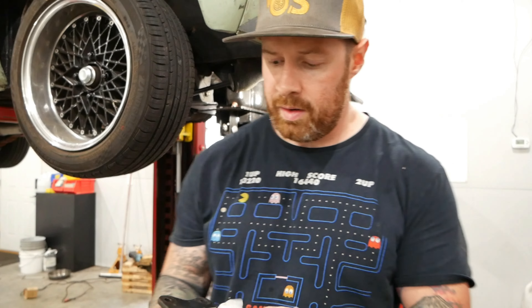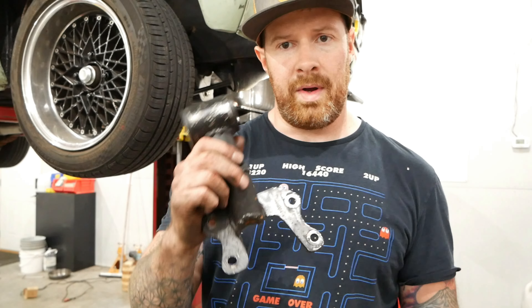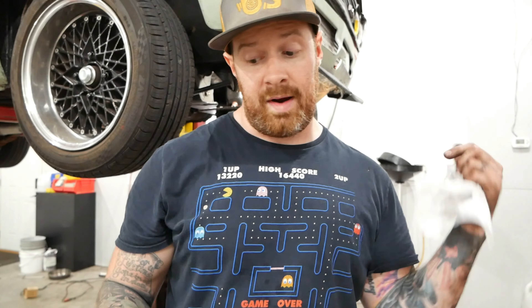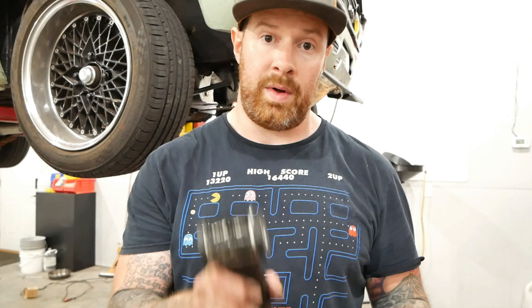The car's up in the air now — it's a little easier to get at this motor mount for the passenger side with the car up in the air. I'm going to repeat the same process I did with the driver side: push these bushings out, rework the rubber ones, get those in here, get this thing back together, and hopefully we can take this thing for a drive.